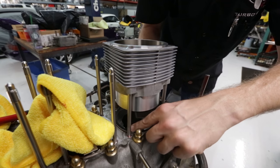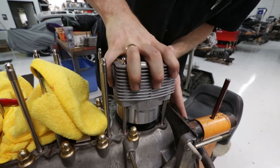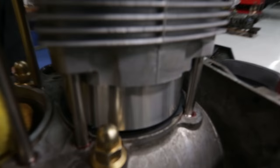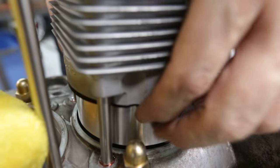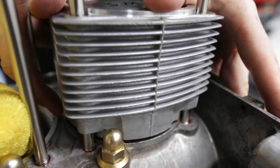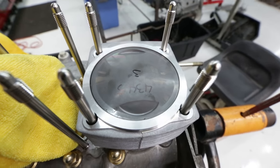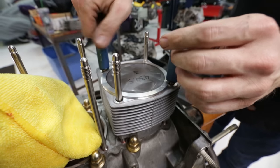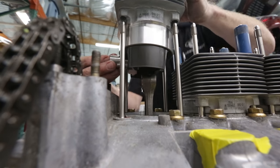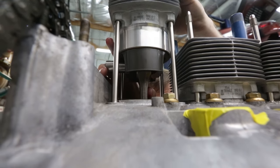This is the factory gasket. It's coated in Viton, so it's got really good high temperature, oil-resistant seal on it. Very thin coat — you've got to be careful not to pinch it. If you do, we start from square one. We definitely don't want to slide it up on the cylinder wrong. Now cylinder one is in, and down it goes. We use these little hold-down tools to keep the cylinders from moving as you rotate the engine, keeping the cylinder affixed in position.